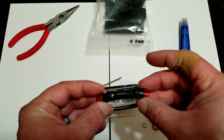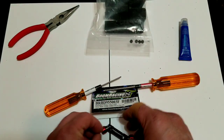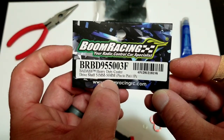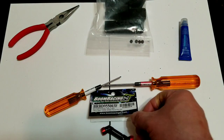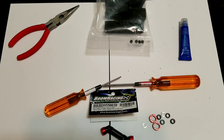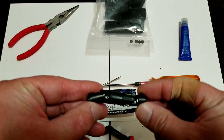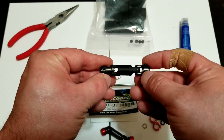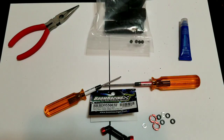For this build series I got the short driveshaft — it made sense to do it while we did the skid plate. The part number you can see on screen, along with the length: 51mm to 56mm pin to pin. The actual measurement of the factory driveshaft is basically 52mm. This is my out-of-phase transmission-to-transfer-case driveshaft right here — as you can see, clearly out of phase. We're going to go over replacing that.